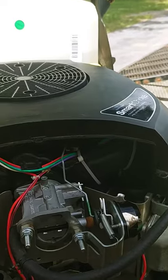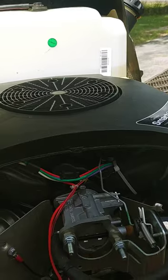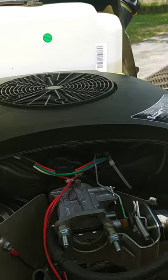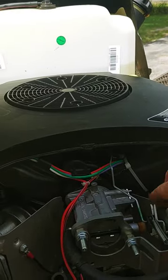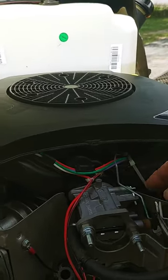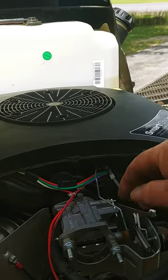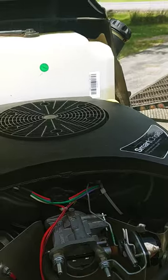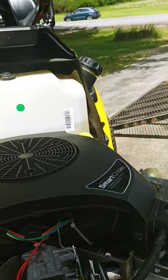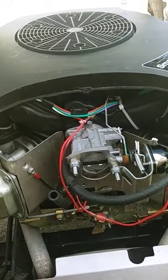You've got three things working this choke: you've got this, which is coming out of the pressure switch — this is holding 14 volts, which heats up the coil inside the thermostat, which regulates how far this opens and closes. Then you've got your wind vane that, as the motor turns over, opens the choke just enough to get things working. Anyhow, I hope this helps somebody out. Talk to you later, bye.